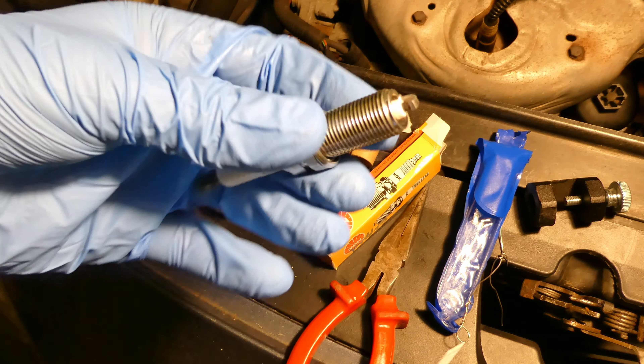It now shows zero with two dashes. Switch the car off, wait for the BSI/ECU to shut down completely, then flick it on again. It shows 19,850 miles - not exactly 20,000 miles but that's fine. It's about 150 miles off the 20,000 but that's still all right - the service counter has been reset.